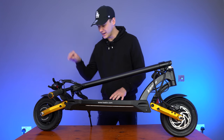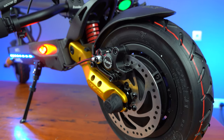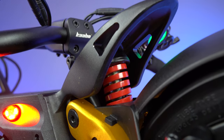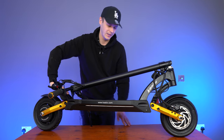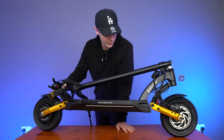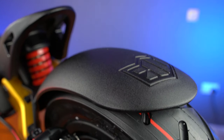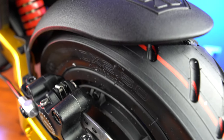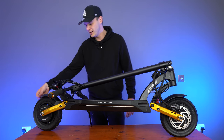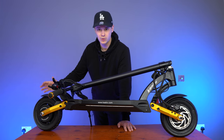To finish up on the deck, there's a big reinforced kick plate at the back of the scooter. All performance scooters that go over 30 to 35 miles per hour should have a kick plate — it helps you to lean into your ride, put your back foot on it, front foot in front, hands on the grips, and lean forward. Directly below the kick plate is the rear fender. From Jimmy Chang's review of this scooter, when riding he was getting quite a lot of dirt and water splashed up on his back — there is room for improvement there, and it would be nicer to see the fender elongated a bit more.